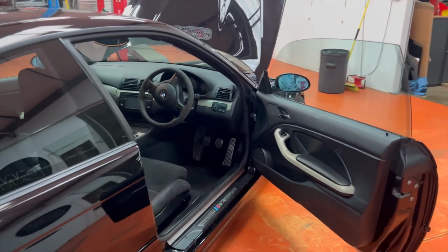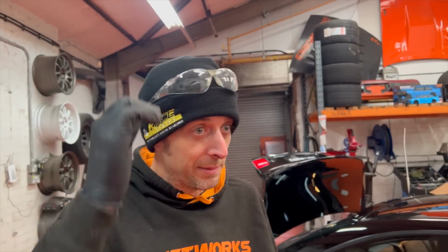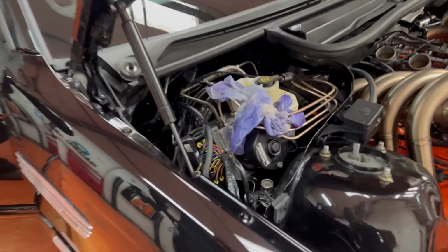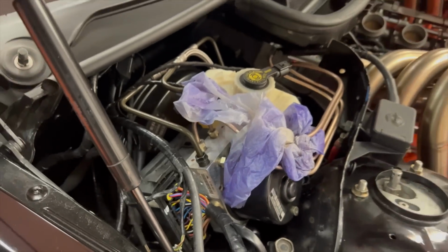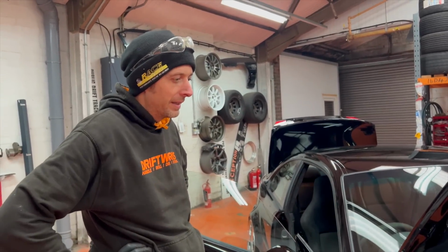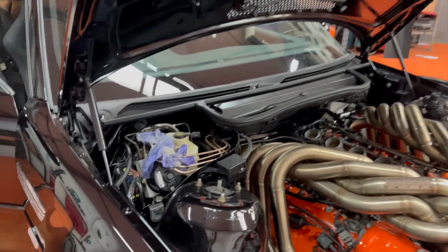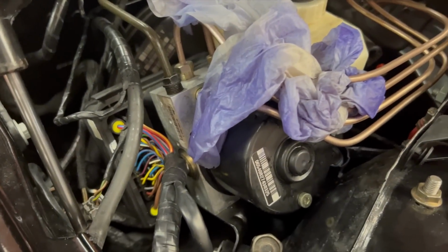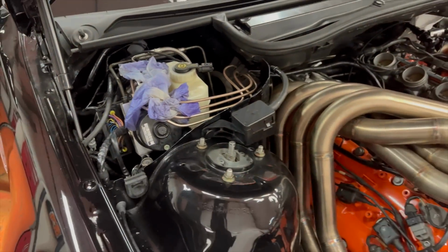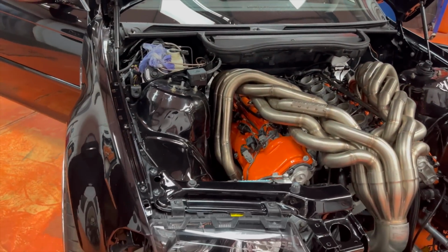So we've got a battery on. We unfortunately, although we have a gearbox and a clutch slave, haven't got any brakes or brake fluids. We had a bit of a boo-boo with the distribution block on the ABS there, and we're waiting for a new one, but actually we ordered it probably a month ago, and only realised about a week ago it hasn't turned up, so get back to ordering another one of those, because it's got a stripped thread in that, but that means that we can't fill the brake system and we can't fill the clutch system as a result. It's got a leak underneath as well.